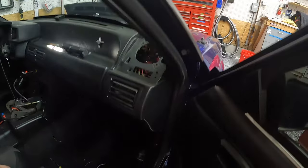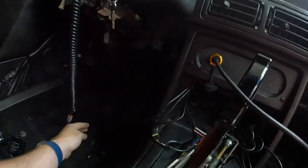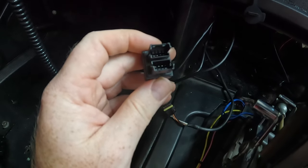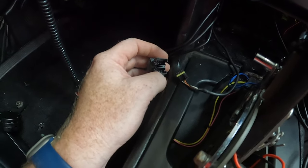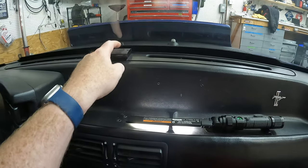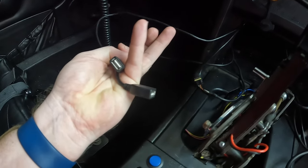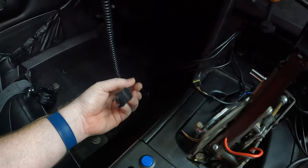Let me go in the car and show you where we're at. The car is off, the ignition is off. I've got a splitter here for the screen — these two connectors here, this one is a CAN connector for the screen that goes into this CAN splitter connector. I don't know that you have to do this, but I read somewhere that you should unhook all your CAN devices, so I went ahead and unhooked this during the update. I also have a GPS speedometer module 2, right here, and I went ahead and unplugged it from the USB ports.